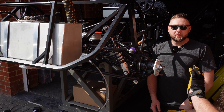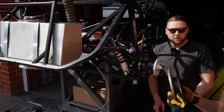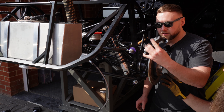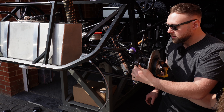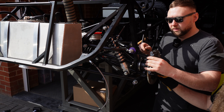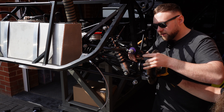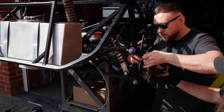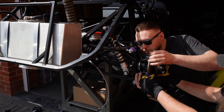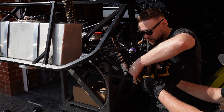We've picked this part first because this is by far going to be the easiest. The disc is on. Now we put the carrier on, which bolts to... there we go, like that. There's only four options and I was still wrong. Once you've got the carrier on, that allows you to put the caliper on. The carrier sits awfully close to the disc but that is normal - don't be afraid.